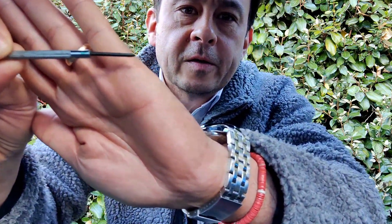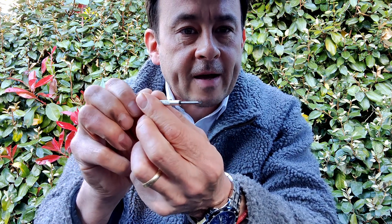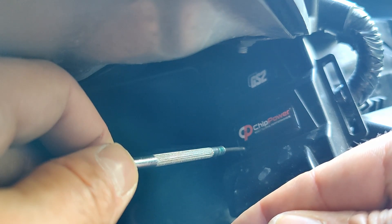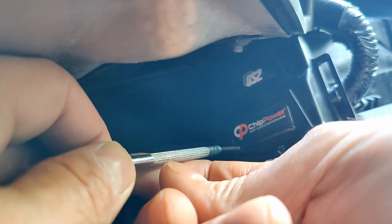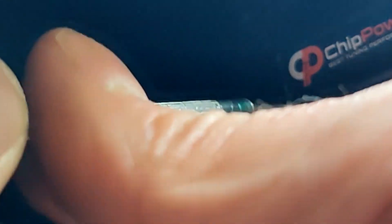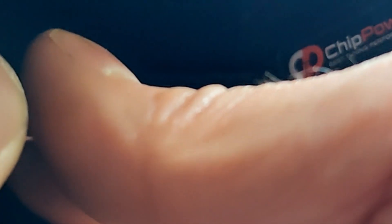If you look closer here you'll see a little bit of green pen. I've marked it just to help understand how many times I've turned it, because the screw is so small. So back to this little screw — with the screwdriver on the screw, just turn it until you've done one full rotation. Do that six times; I'm going to go to the left, which is counterclockwise, to increase the power. There's the green mark — that's one, two, three, four.